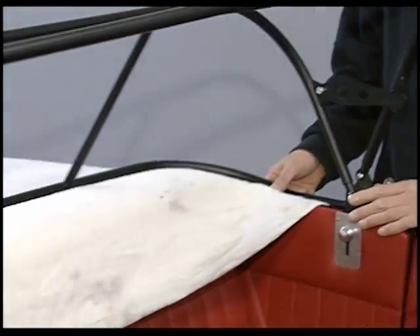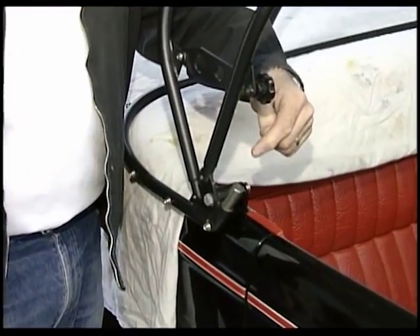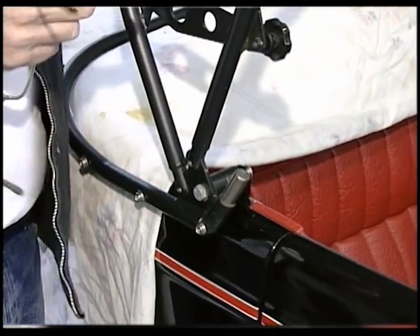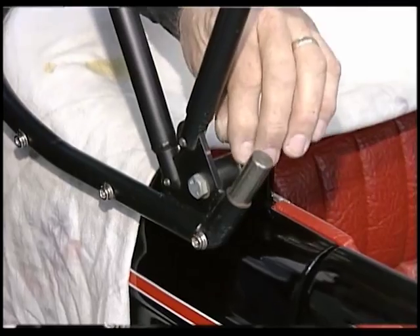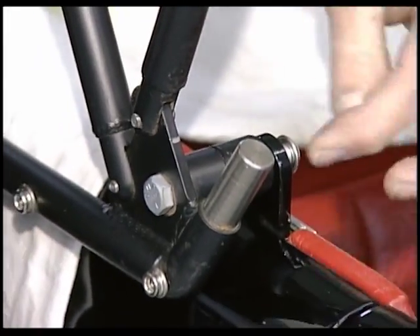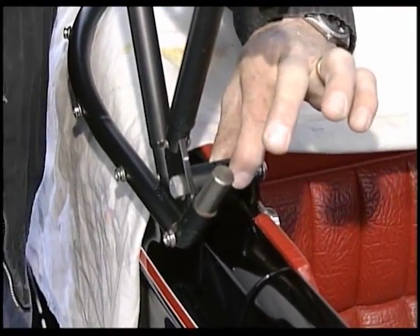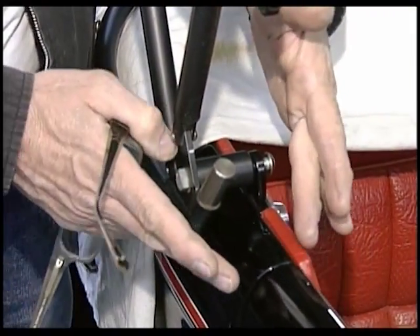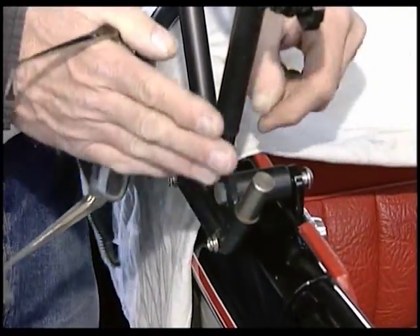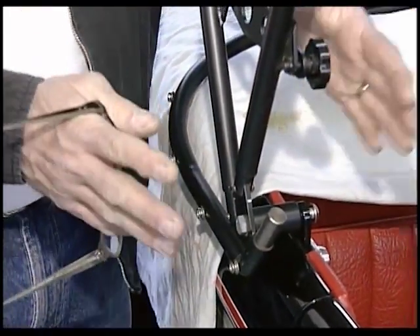These tabs are designed to work with a factory Ford 32 tab — it's about three and a quarter inches back, an inch up. We have the measurements and we can send them to you. In hot rodding there's a hundred ways to get to the same place. This gentleman made his own tabs — they slide up and down and are set inboard, so we had to put an extra spacer on here. Some fiberglass bodies are thicker at the back, so you may need to add a washer or trim our spacer if the tab is out too far. Those adjustments can all be done very easily.